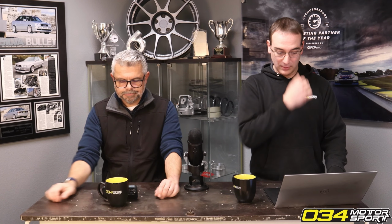We noticed it a ton. If you get sticky tires on there, you'll just get hard transitions. You'll get the thing clicking and moving around, and you've set your camber, but now your camber's over here, and then your camber's over here, and it's not a great performance solution. So there's quite a few options in the market.